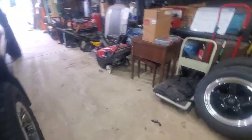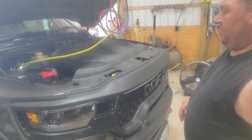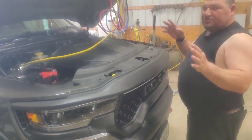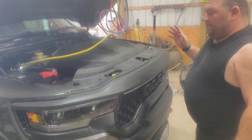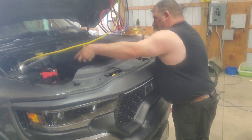I bought five gallons of Mopar coolant. I'm gonna drain the system enough so I can pull the hoses without it leaking all over the place, then seal it back up right away. I'll top off the tank with the fill hole, pull vacuum on it, and top it off the rest of the way. So there are a whole bunch of push pins around here — the instructions say you'd be swearing about it but it's really easy. First thing you just get this cover off — it pops up.